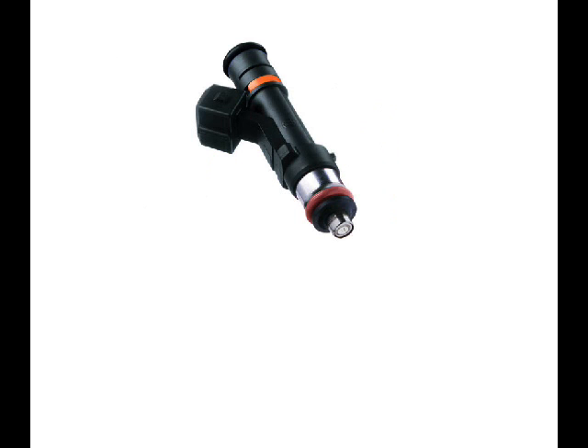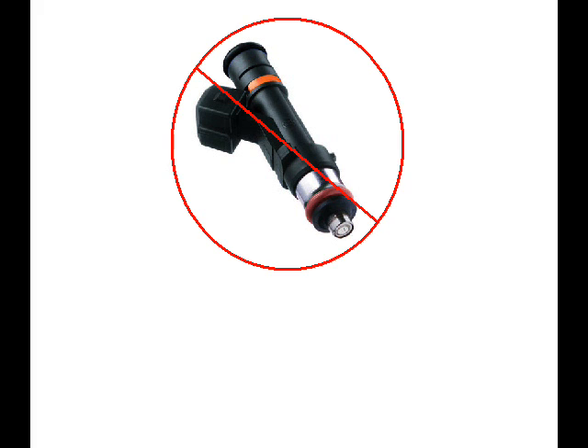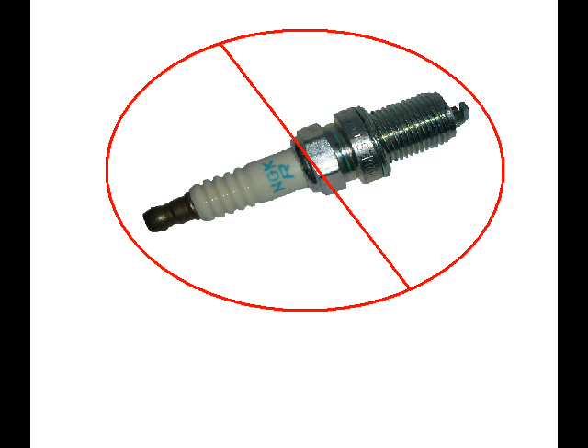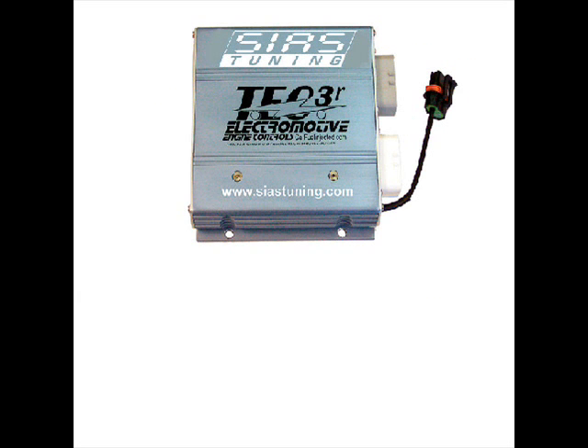To accomplish this, there are a couple of things we need to do. First of all, we have to cut off the fuel injectors — as the term states, deceleration fuel cut-off. Another thing we have to do is cut off the spark plugs. You don't really need them anyway, since there's no fuel to ignite. All of this is done by the ECU, or engine control unit.